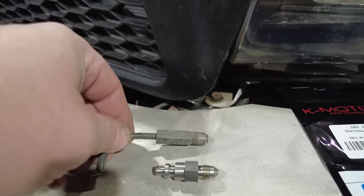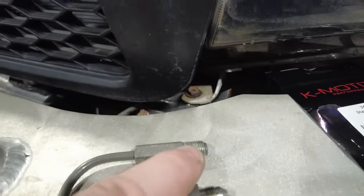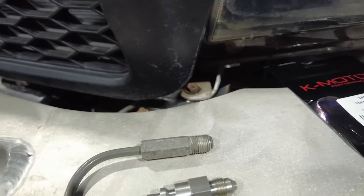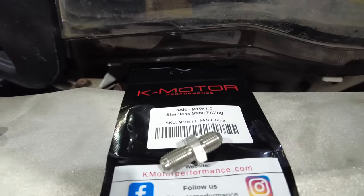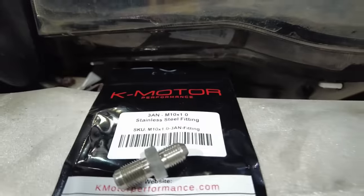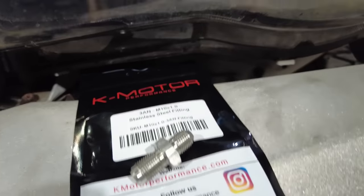The problem is the Tacoma does not use this style of connection. It uses a flared fitting with a big old tube nut on it. Now, obviously this came with my kit, so I could not use it. So what I did is I went ahead and ordered this fitting, and I'll put a link to this as well as all the other parts in the description below. This is an M10 by 1.0 to -3 AN, or sometimes referred to as -3 JIC. This will simply screw into the master cylinder. I'll tighten it down, and then I can hook the line up to that.